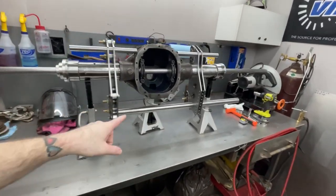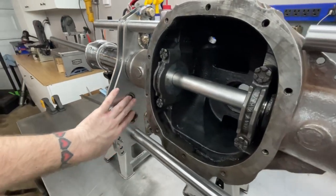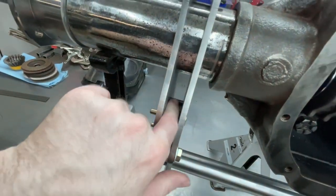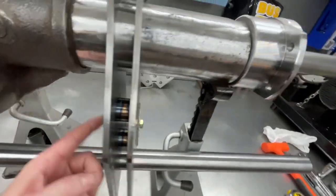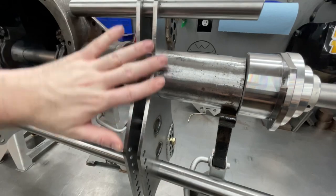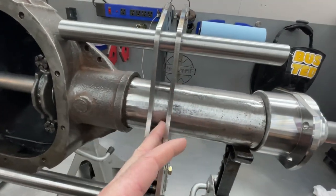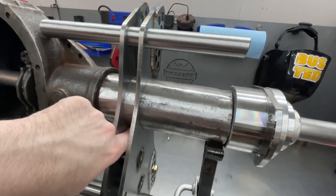Here we've got the Ford 8.8. From the last video, we got these plates welded up and got our spacer support bushings in, so those are welded up permanently. Some people don't put anything in these, but I like to — it helps keep the structure as solid as possible and keeps it sturdy for welding. Someone mentioned on my Instagram that I won't be able to weld this all the way around.